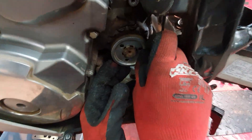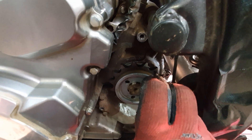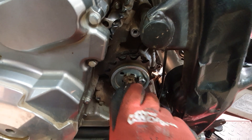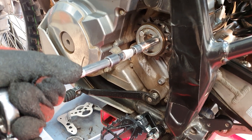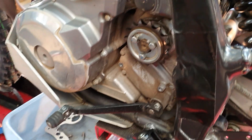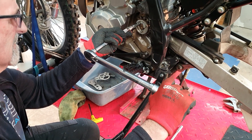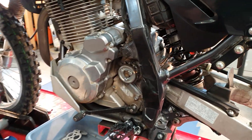Hell's getting the three little bolts for the front sprocket ready, using 243 Loctite — the blue Loctite. He noted the rear sprocket had a pink soft Loctite, not heavy-duty super Loctite. The retainer and O-ring go on, then we line up the bolts. We rotate the retainer so it slides onto the spline, then about half a turn to lock it in. The gearbox is in first gear and the torque setting is 6 Newton metres — about 4.5 foot-pounds. That's on and going nowhere with the Loctite.